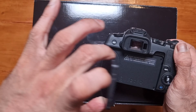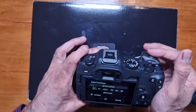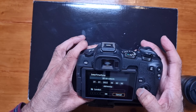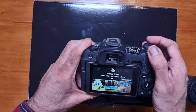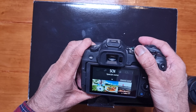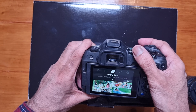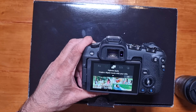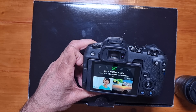At the bottom, that's the tripod mount, and that's where the battery goes — I'll put that in now. I have an SD card here. This camera supports a UHS-II SD card, which is slightly expensive. This one is from my Canon M50, a 64 GB card. It does not have to be UHS-II — you can use UHS-I, which is cheaper. A 128 GB UHS-I card on Amazon right now is around £22.